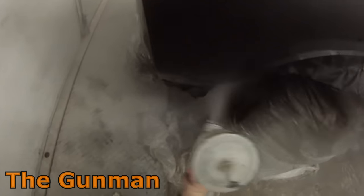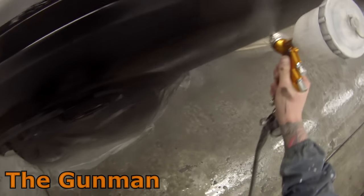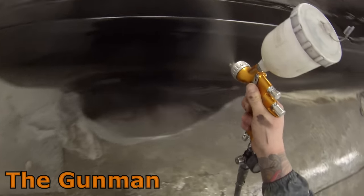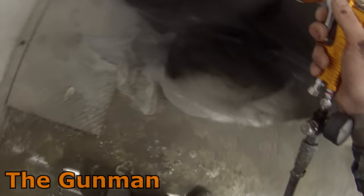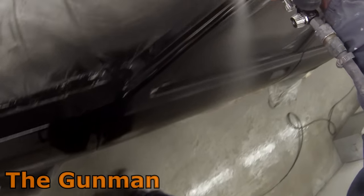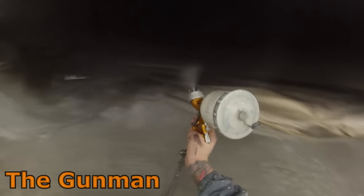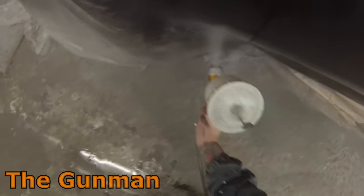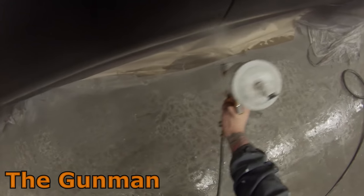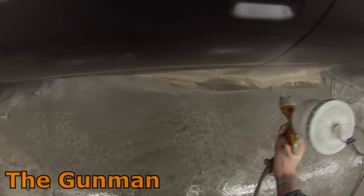The owner is really happy with it and I was pretty happy with it too — I learned a couple of things I'd do better next time. Also, another advantage of putting those panels back on first was that if you scratch them, you can't just touch up a colour like this because even base coat is shinier than that flat clear. For the second coat I simply mixed up another little batch of clear coat and continued straight on. I'd warmed up the clear so there were no flash-off times at all — and this is perfect product to judge flash-off by, because it goes matte when it's ready. If it's still shiny, it's not ready.